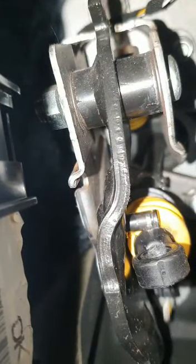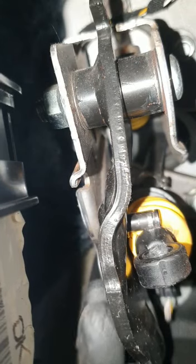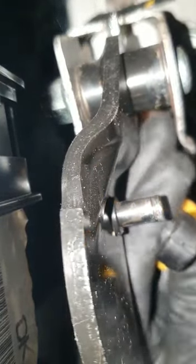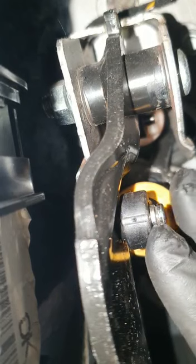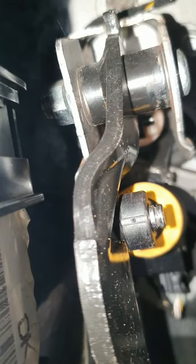And I can see the yellow stuff, and I can see the pivot on the pedal. So yeah, alright, so this is what you want to do. Let me see. You should have a little clip there that sits in that groove that will keep that on. If you can find that clip or replacement, your clutch pedal should be fine-ish temporarily. But I'll show you when I get the new one what this one is now probably missing, which has also caused it to come off. But if you can find that clip, I wouldn't be surprised if we find it, to be fair. Yeah, we're going to need it for the replacement.